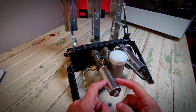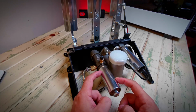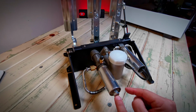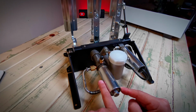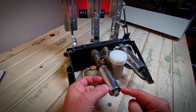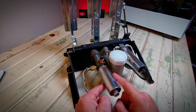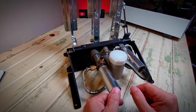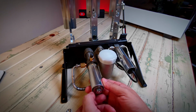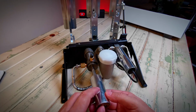Inside this, it's a stainless steel tube. Inside here, we've got a rubber bump stop and a spacer. Basically, when we activate the brake pedal, because it's bolted with a washer on the end, this rod squeezes down and is forcing the rubber bump stop and the bush up together. It's obviously not able to expand too much because of the stainless steel outer casing, and that's where you get your feel from. So we're going to take it off, which is just undo the two nuts on the back, and we'll have a look inside.